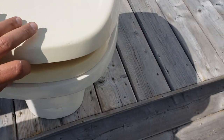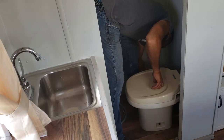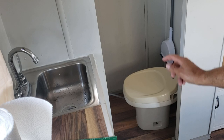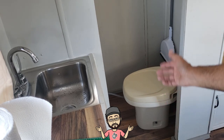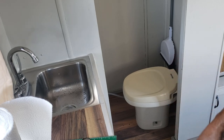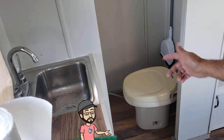I've got our toilet all cleaned up — looks a lot better. So let's go get that thing installed. I've got that toilet installed. I have to pick up some little clamps to attach the hose along the wall — I decided to run it on top. I know we can see it, but this way I'm sure that the hose will be drained rather than running underneath. And I didn't have to take any walls apart. The camper that I took it out of had a similar setup with the hose showing, so I'm fine with that.